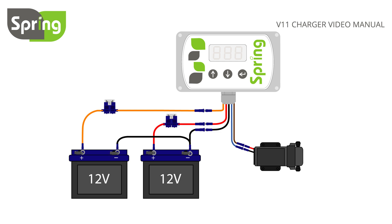When the vehicle engine is running, the alternator turns over, raising the voltage above 13.5 volts, which starts charging the leisure battery. The charging function is active when the controller is on or off. When it is activated, the display will flash CHG for charge.